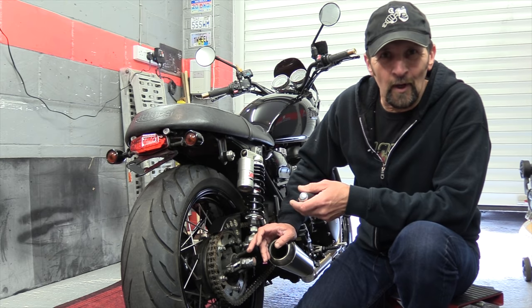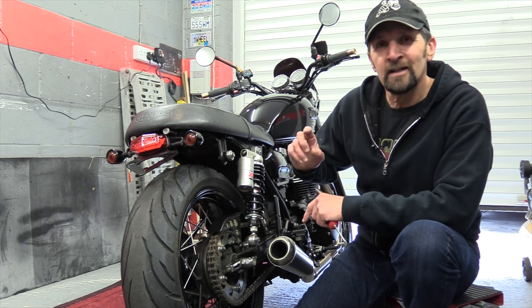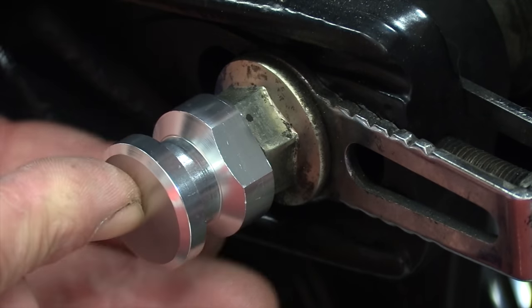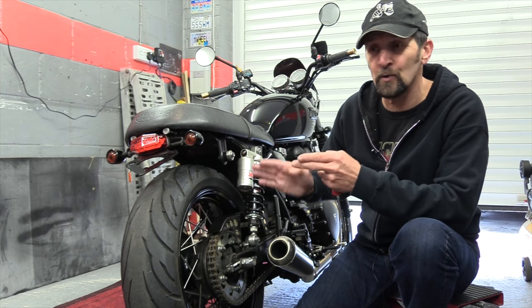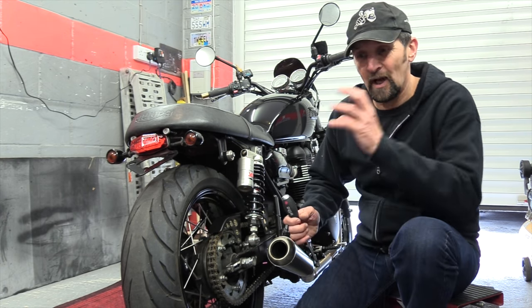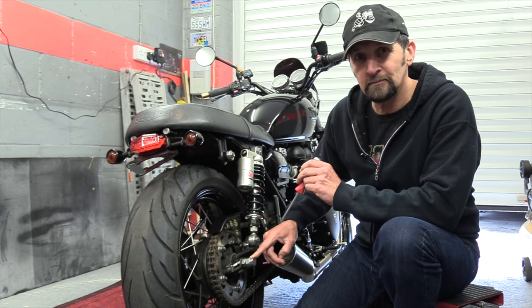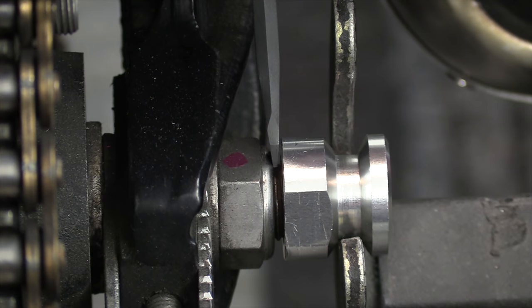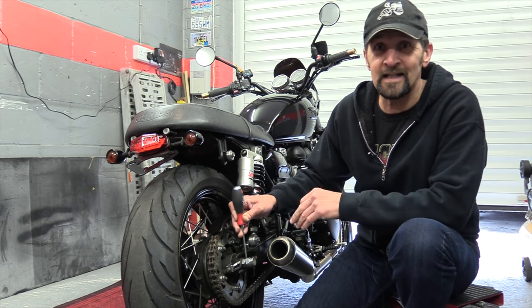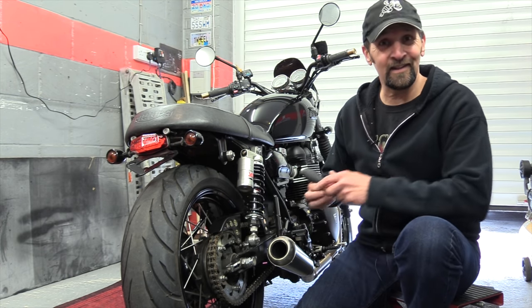Right, okay, a straightforward idea, I'm sure you'll agree, and probably one you've thought of yourself. But a bit of thinking has gone into this, and that's why I really like it. The bobbins are sided. On the left-hand side, you've got a shaft that goes inside the axle that then locates the threaded bar down the center of the axle hole so it's not touching. And as it comes out and emerges, this side bobbin is different. It actually goes over the axle, and it's machined just deep enough so that it pinches up on the axle, not on the nut. It actually pinches up on the protruding piece of threaded axle. That gap is between the bobbin and the wheel nut. The reason for that, quite obviously, is then you can back off the wheel nut in order to adjust your chain. Quite important, really. Clever thinking.